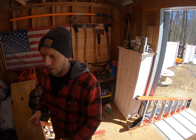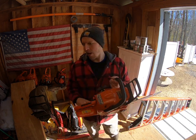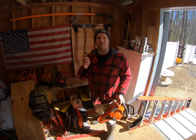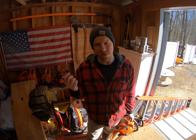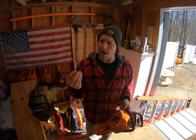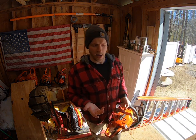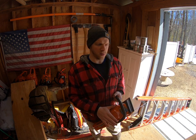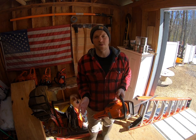Our Husqvarna 240. Let me grab it here. Yeah, you probably don't recognize it now. I didn't film this, but in the video I originally posted on the Husqvarna 240, I said there was no adjustment on the high and the low. Come to find out, you needed a specialty tool. The other six chainsaws I have, you can use a regular flathead, but on this, it was a really particular splined screwdriver, so thank you guys for pointing that out. Searching for that on Amazon, I ended up getting a whole new carb, fuel line, fuel filter, air filter, literally a full tune-up kit with spark plug for $20 for the Husqvarna 240.